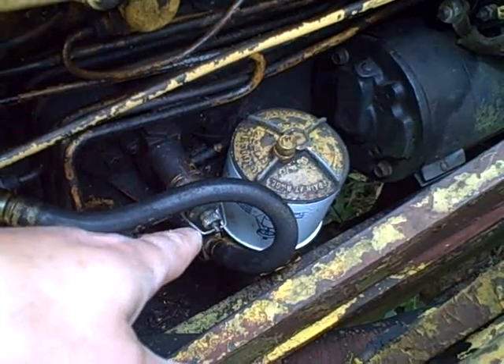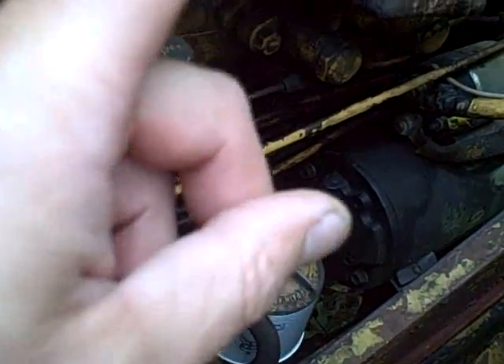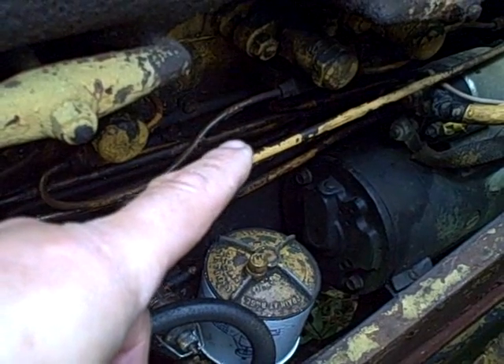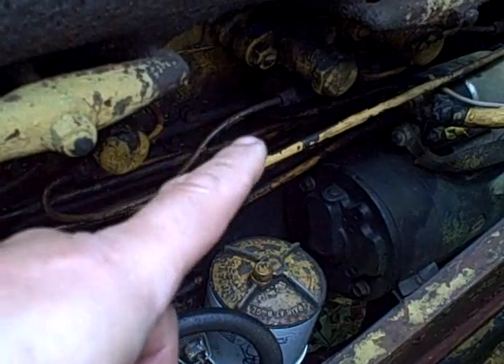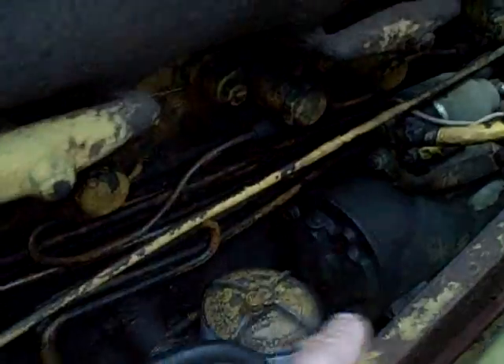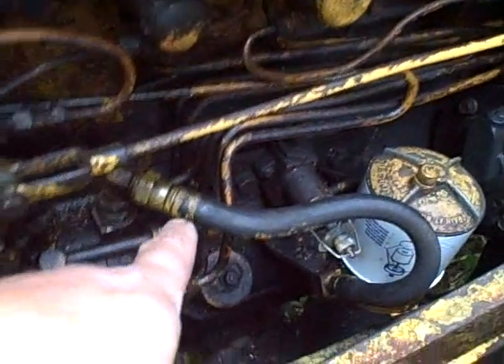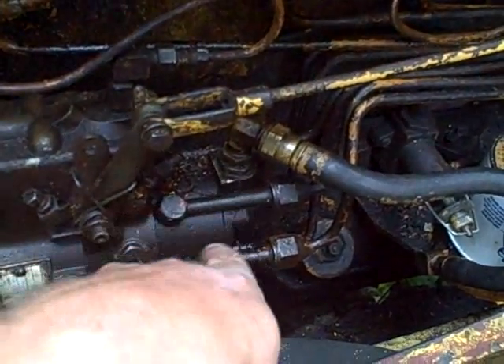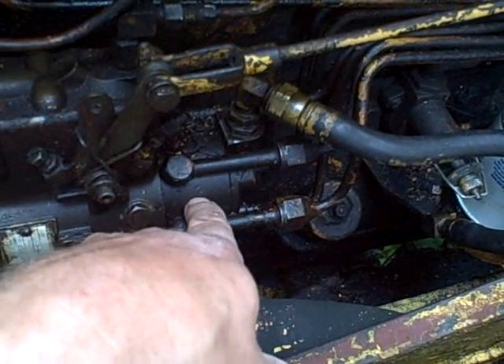There is no mechanical lift pump. So prior to the electric fuel pump that was added to this later by somebody, the means of transfer for the fuel from the tank was gravity — gravity flow through both filters down to this point and up into the back of the injection pump. Right there in the back of the injection pump is the transfer pump part of the pump.